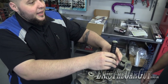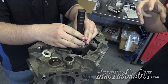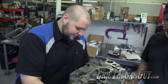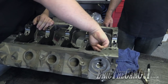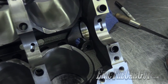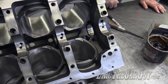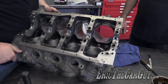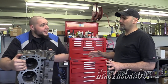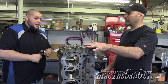This is a much shorter tool than the one you had before. Yes — the other tool is a whole lot easier; this one's not so much fun. The other tool had a cone that lined things up and kept it all straight and true. You can't do that on this one because there's a little machined surface and it's cut out, so it just refuses to go in straight. And cam bearings are also tapered — the bearings that are way down inside are smaller than the bearings at the front on this Ford.